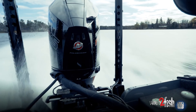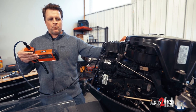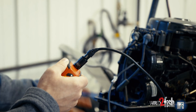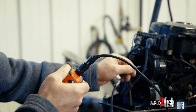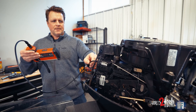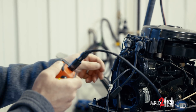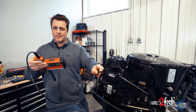On top of that, I want to move those cylinders periodically so they're not positioned in the exact same spot. What that does is it helps redistribute lubricating oils that are in that cylinder, and on a four-stroke, for example, it helps re-spread oil from the crankcase up into those cylinder walls. It's all about just a simple turning over of the engine to prevent the rings from sitting in the same place for a long time — that's a high risk area for rust to occur, which over the course of a 20-year engine life can reduce performance pretty significantly.